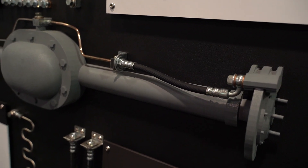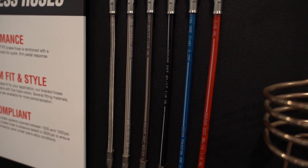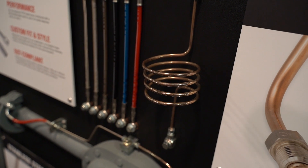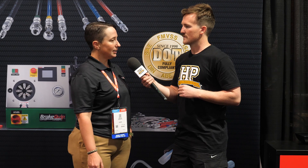So what's the most common material we see brake lines in, and maybe the sizing as well? Traditionally coming off your vehicle is going to be a steel line. We've found in the industry it's better to switch over to copper-nickel — it gives you better properties for corrosion resistance and it's a lot easier to work with when you're bending and flaring it. It's a bit more ductile than steel and more corrosion resistant. We also have a special annealed stainless that is easier to flare, and those are for different applications.